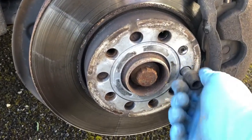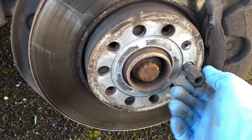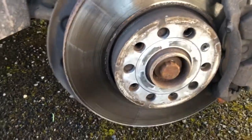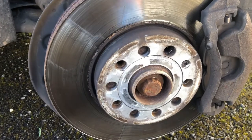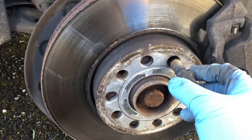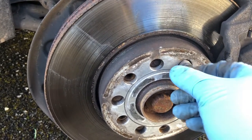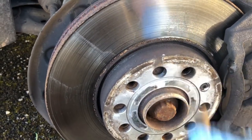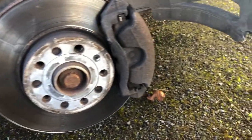As you can see, that hole there threads in fine — perfect. But when I was redoing the brakes last time on my car, I was in a bit of a hurry and I rushed it, and I accidentally cross-threaded this top right-hand side thread. You'll see it's not going in there properly. So basically what I've had to do is go away and buy a tap set.